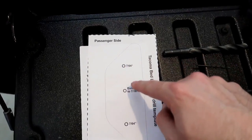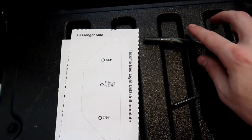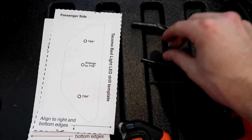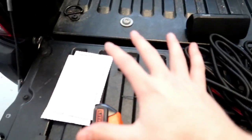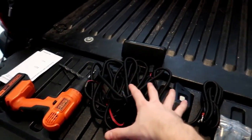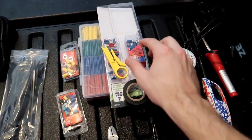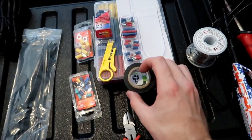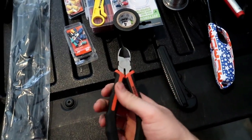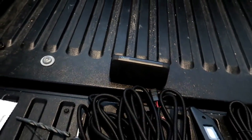We're gonna be needing a 7/16th bit and a 7/64th bit for drilling. For the 7/16 hole — the one in the middle that we're feeding the cable through — I'm actually gonna use the 7/64 to drill my pilot hole, expand it with a quarter inch, and then do the 7/16th, because this is fiberglass so I want to be careful. We'll need a drill obviously. The rest is related to cutting the wires shorter: you'll probably need heat wrap, a wire stripper, some crimp-on connectors, electrical tape, solder, a soldering iron, a lighter to melt heat shrink wrap, wire cutters, and a utility knife. And you can't forget a Bluetooth speaker so you don't get bored during your install.